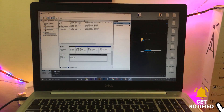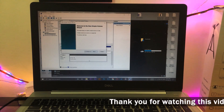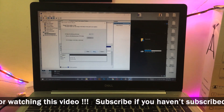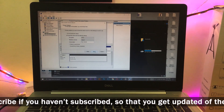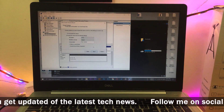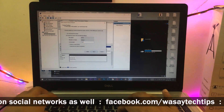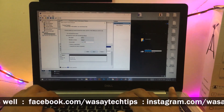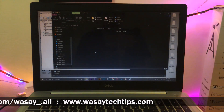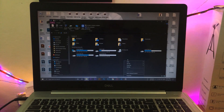Now in order to make it visible on your PC, right-click on it and select New Simple Volume. Press Next, assign the size, assign drive letter H, select NTFS as the format, and for its name I'm just going to type 'Local Disk'. Press Next and Finish. It's now formatting and our new SSD is now accessible.